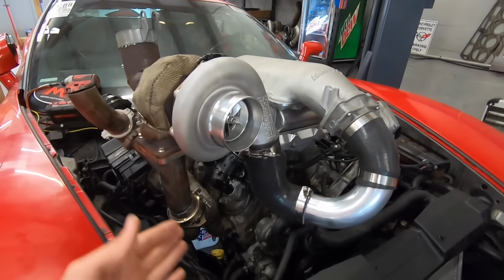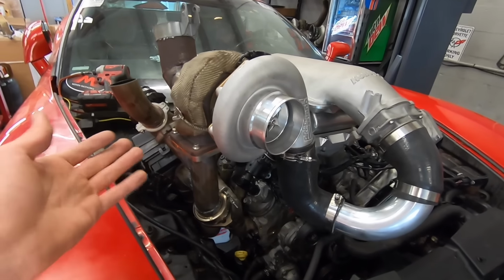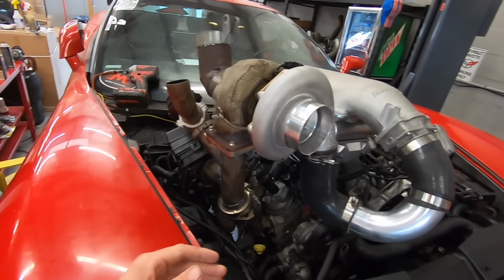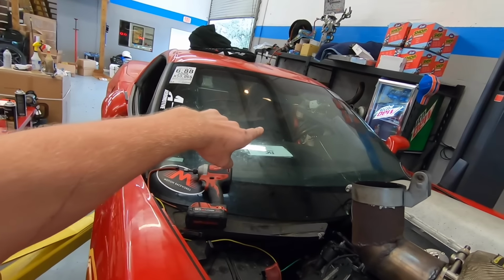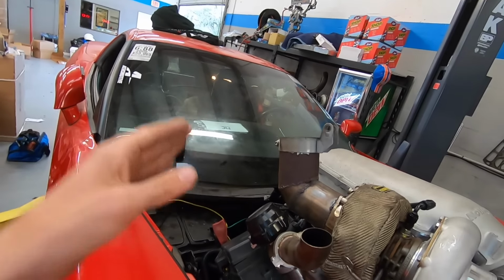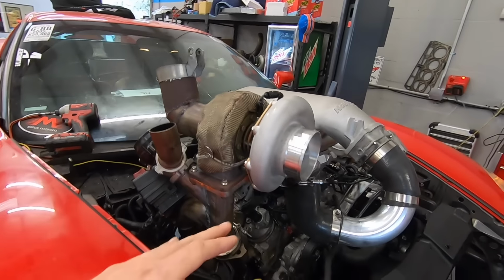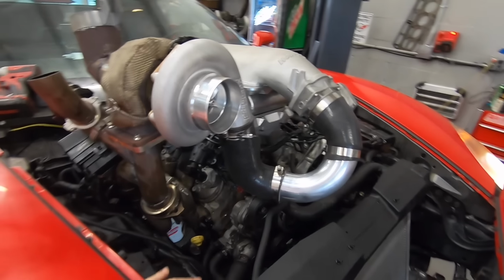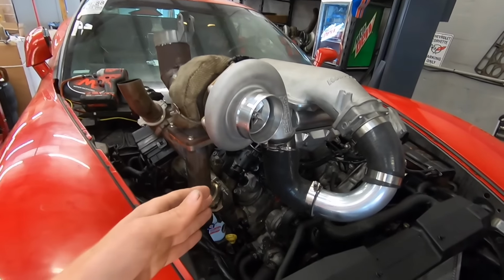Being able to spin it higher might give us a longer power band, which might be good for this powerglide. We will see when we get to the track, but Jeremy, a.k.a. Pro Tuner for Motskis, a.k.a. Tuning Grandpa, is in there right now making some changes for these bigger injectors, and we're running on straight E90, Ignite Racing E90 today, so our fuel blend is a lot safer.